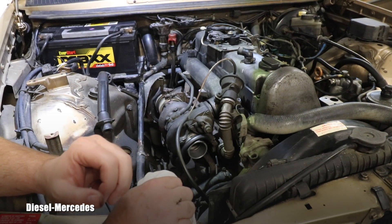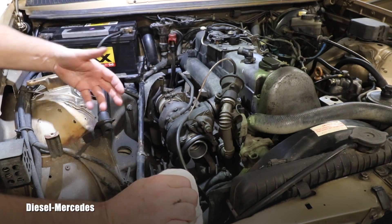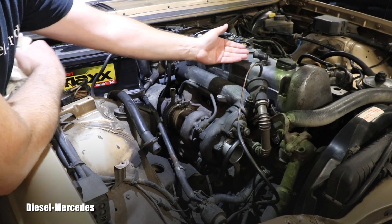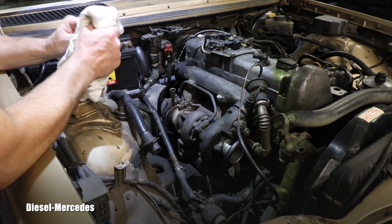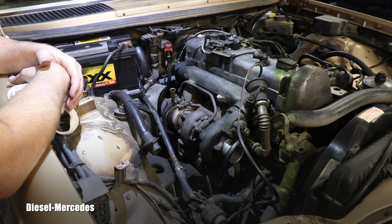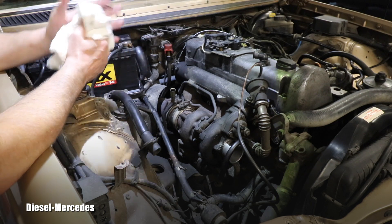This is a great situation. I can't enjoy this view enough — which I have right now. It was crazy before, right? You couldn't see that engine and the turbo at all. I was also observing the blow from this elbow — it's absolutely minimal, so that's something I don't need to really worry about, and it will be easy to hook it to this return pipe and direct it back to the engine. This will need a support so it doesn't get damaged from excessive vibration, which obviously these engines have.